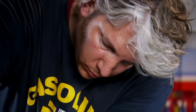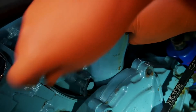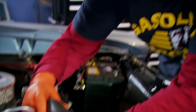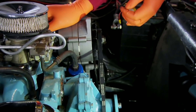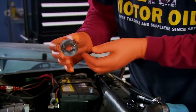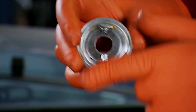There's no point having all that extra cooling capacity if the rest of the system doesn't function. I need to know the cooling kicks in at the right time, so I check the thermostat which controls water flow around the engine. Somebody's actually nobbled the thermostat - there are bits missing and somebody's put in a washer instead to stem the flow a little bit. We'll obviously replace this with a working thermostat, but with our improved radiator and fans hopefully this should never be a problem again.